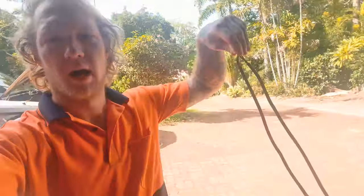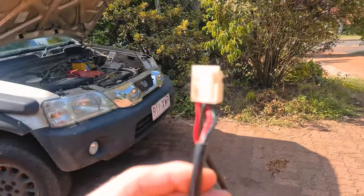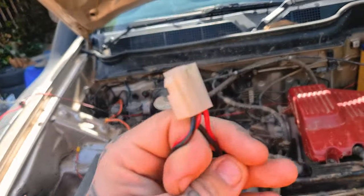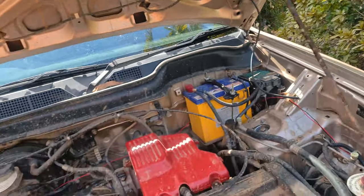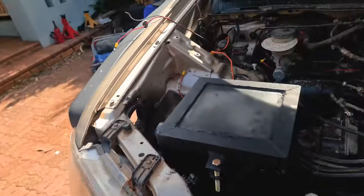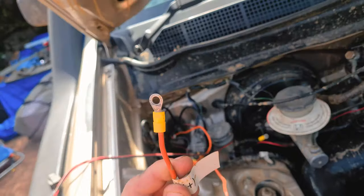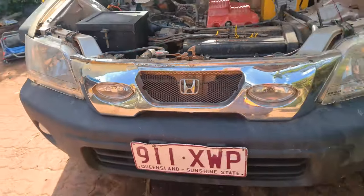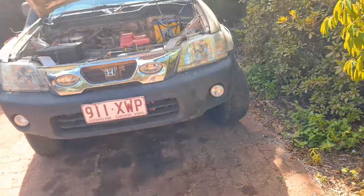In the last episode I pulled out that wiring harness for the roof light. The good thing is, as with the other wiring harness I have, it's a dual-channel one. So I'm going to cut that connector off, put some ring terminals on, wire it up to my battery, and chuck some spade terminals on these instead of ring terminals. Then I'll be able to test those and have my UHF once again.